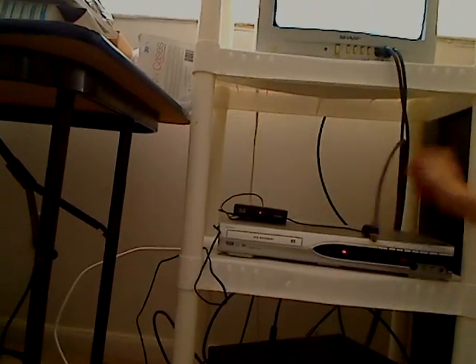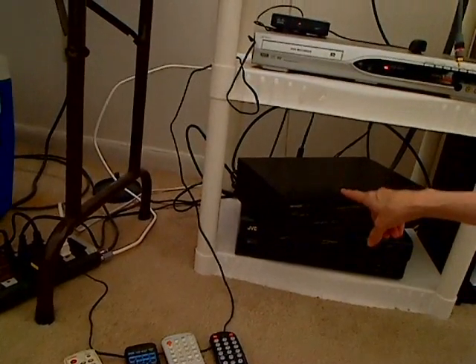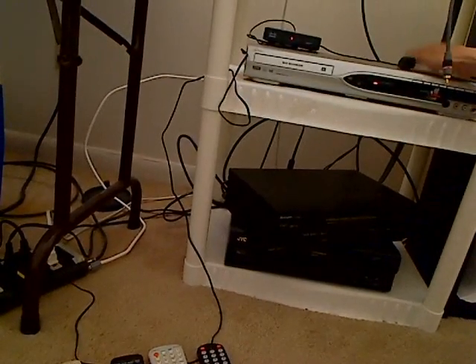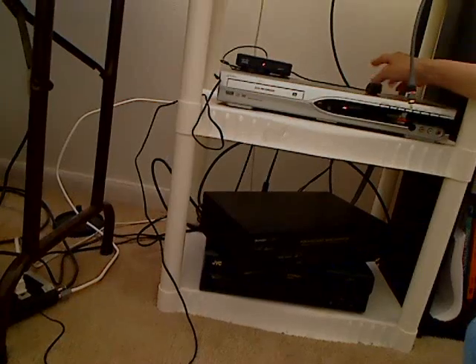For video in, I've got a yellow one going into the yellow socket — that's the video. Then I've got the white one matched into the white socket. Now you need video audio cables going out from your VCR — you look in the back — going out from your VCR, and then in to... not out from your DVD player, excuse me. Out from the DVD player, then in to your VCR. If you look at the back, you can figure out which ones are out and in.